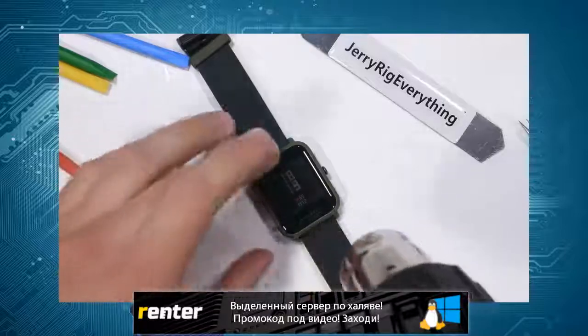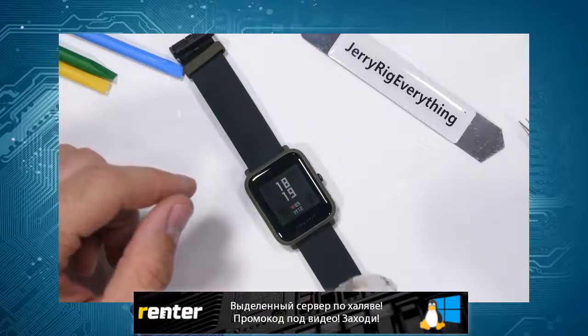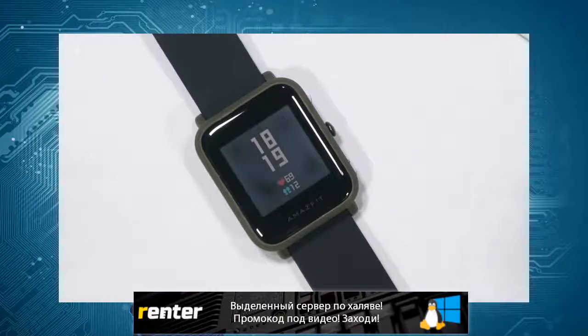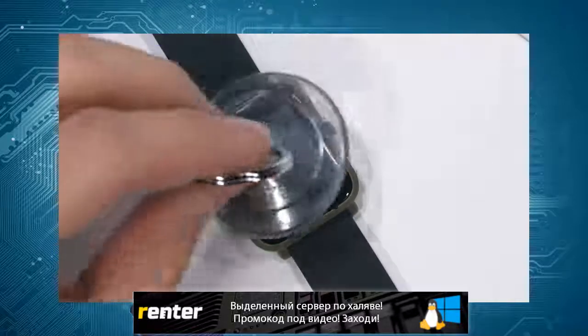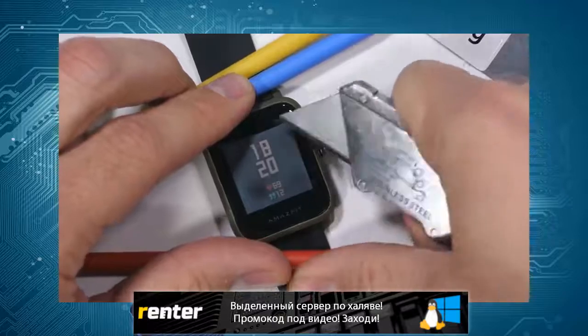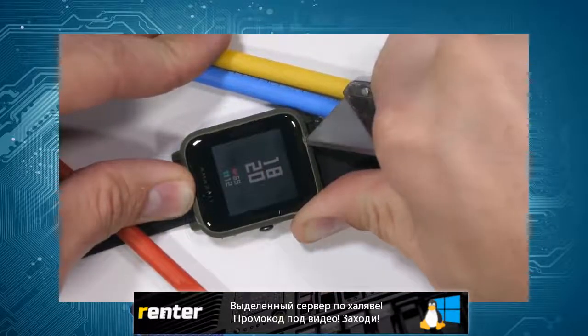Let's add some heat. Heat is what I would normally use to soften the adhesive between the glass and whatever frame the glass is stuck to. You can see the 1.28-inch display pixels going from their normal black color to a softer gray with the heat. But even then, with extreme persuasion, the screen remains intact. My razor blade can find no entry point between the glass and plastic layers.